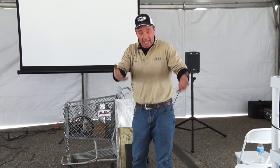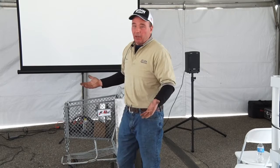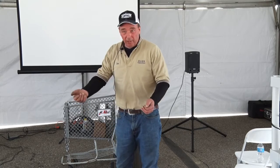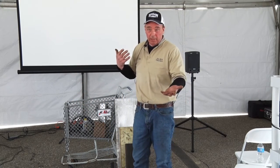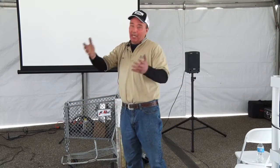So now I drop off my friend's horse, say I'm going riding. I got to my friend's house, loaded her horse on. I just added 1,500 pounds more to my brakes. I need to adjust my brake box again. So get out on the road in front of their house, adjust it in. You're going to raise the power because you have more payload. Then you get to where you're going, you drop her off. I got to drop it back down.